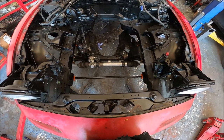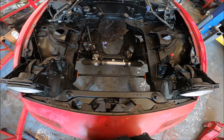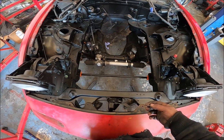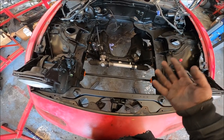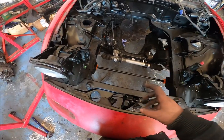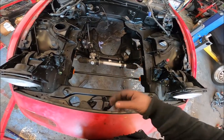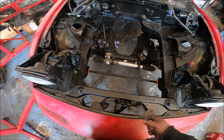The anti-roll bar is now bolted up. That's far more work than any other anti-roll bar I've ever had to do up — not because it's complicated, it's literally two bolts either side. But because of these new bushes, which are a very, very snug fit to say the least, I had to use a trolley jack to force the ARB into the right place, and then I had to use some massive mole grips to literally squash the bracket down to the correct shape, because the big fat bushes were forcing it out of shape which meant you couldn't get any bolts in. So a hell of a lot of fiddling about, but that's done.